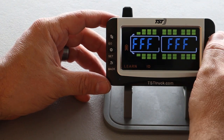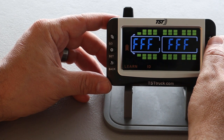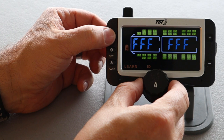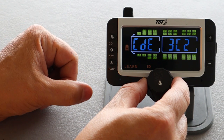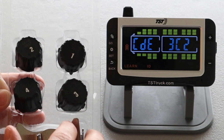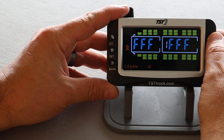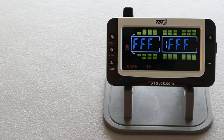And one more. We're going to skip that because I don't have a dually and go over to the other side to the outside tire. Just because I programmed the outside tire on the right side, we'll program the outside tire on the left side. Set and go to read the code, and then we'll press set again and save that. Now I've got all four of these sensors programmed and I put them back in the case in the order that they were programmed. Now we'll scroll through to the trailer tires and start there with the front right trailer tire and repeat the process. So I'm going to go ahead and program these in and then we'll go to the install.